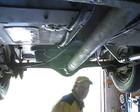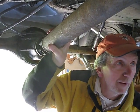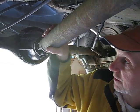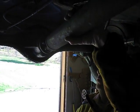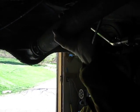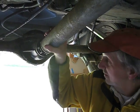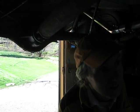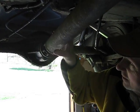That's all nice stainless steel. Here's the rear drive — the pumpkin. The differential on this car right now — it'll do 60 miles an hour and the motor is probably at about 2,500 RPM. It'd be nice to change this ratio so the car would go a little faster; I think it would help the fuel economy. Right now it's nice for the back roads because it'll really pull — it'll pull up any of these hills real easy. I'm surprised how much power that little engine's got; a lot of torque off the diesel. It kind of flattens out real quick — you push the pedal and it lunges ahead and then it kind of stops.